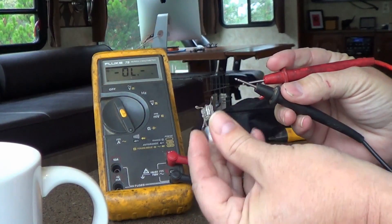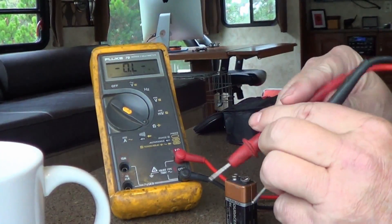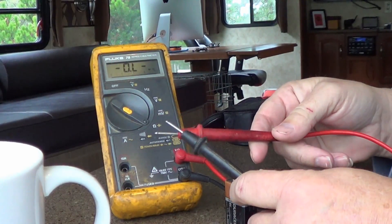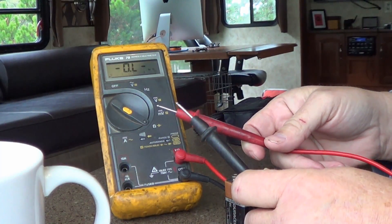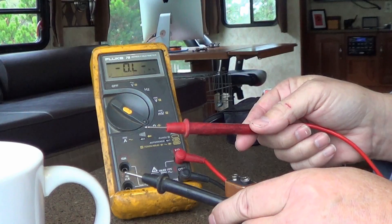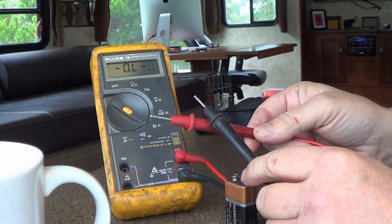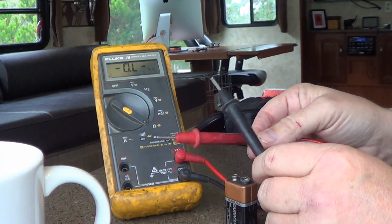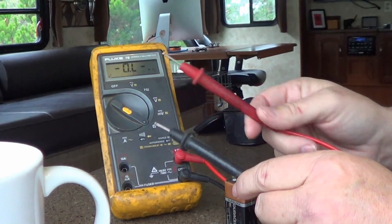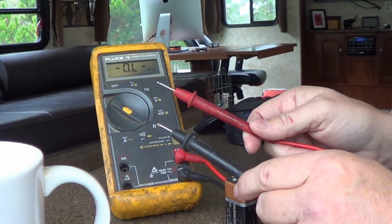In this case it's a standard RV lamp. Three things on the RV where the ohms resistance mode is really good are elements. I've used it to troubleshoot a burnt-out fridge element where the element should measure a certain amount of ohms — I put my leads across it in ohms mode and it showed OL or open circuit, so I knew right away that element was bad. Also the water heater element is another one I've used the ohms mode on my multimeter to troubleshoot.